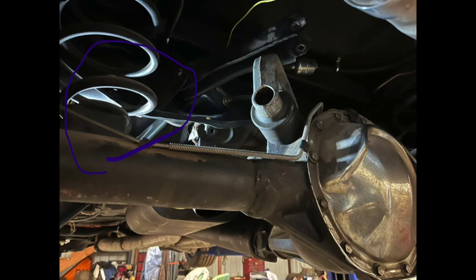What those blocks end up doing is changing the pinion angle. So what I found was that if you raise the rear of the car, the anti-hop bars — there are a couple different brands, but I like these the best — are the solution to get rid of the wheel hop. If your car is lowered, you should look into something like ladder bars or adjustable LCAs, something to that effect.